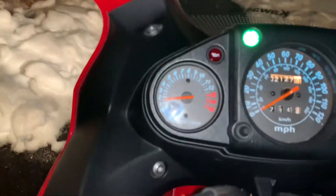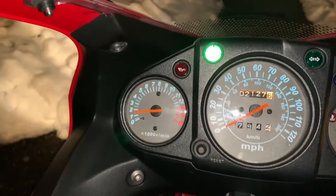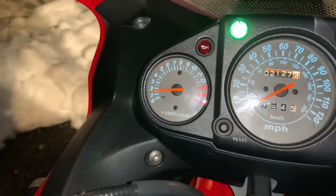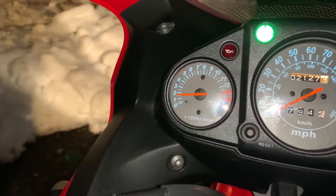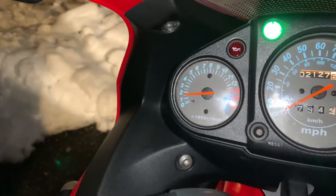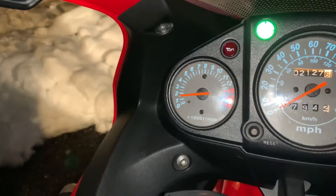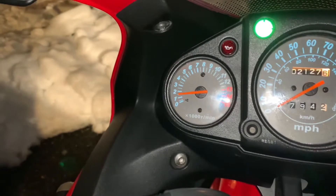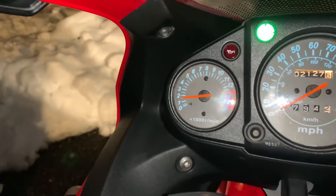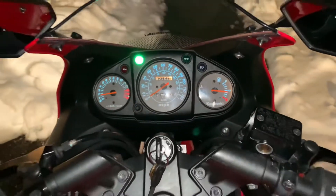Now the bike's warmed up. I adjusted it to around 1,500 RPM, and obviously it went until the bike is warm. The bike's running good. After the new gas and the plugs, I can already tell the idle's a little better. You've got to realize it's very cold out too, so the air and fuel ratio is probably going to be off. But it's definitely better than it was, because with the prior setup — the old gas and old plugs — that idle was bouncing from 1.5 to 2K, up and down. It still drove good, but right now it's definitely more steady, so that's reassuring.